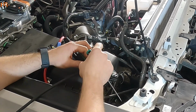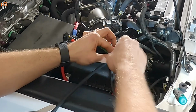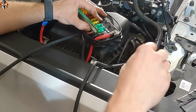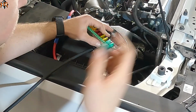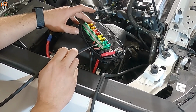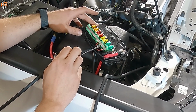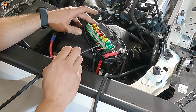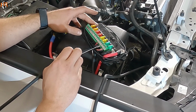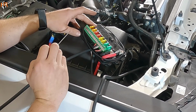So I'm going to take out the DRL from the first light bar. So I'm going to fuse both of the DRL wires from the 2 light bars, and I'll connect it to switch number 2. So it's going to provide 12 volts to both of these wires now. Even if you get a hood mount kit and you want to fuse the DRL function of the hood mount kit with this one, as long as the amp rating is good, and in this case it's 30 amps, which is a lot. DRL is a very low power consuming accessory. It's probably about a 1 amp each. So you could probably do all your DRLs together and even put on a 5 amp fuse without any problems.